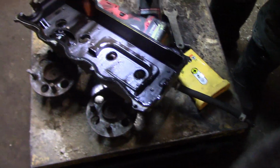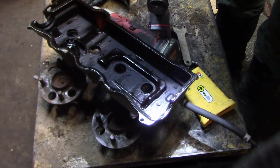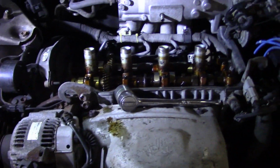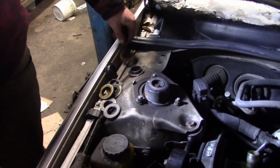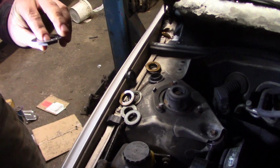So if you guys have a leaking valve cover gasket, don't be afraid to fix it. It's cheap, it's easy, you can do it in your driveway in about 30 minutes. And you don't even have to worry about losing little 10 mil bolts because you don't have to undo any. It's 4, like 4 1.25 inch bolts, plus that's the seal. The bolts are there, the nuts are there too. Super easy, you don't even have to put high torque on them.